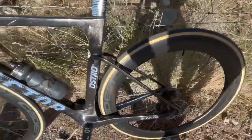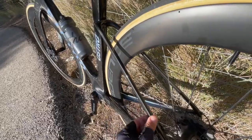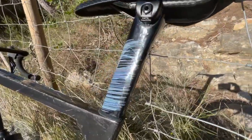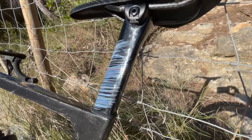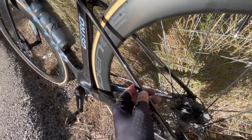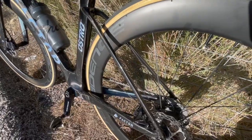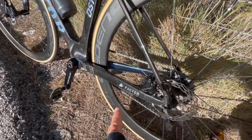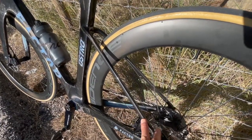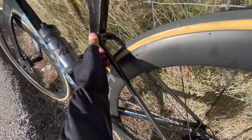The seat stays on the back here are very thin — pencil thin — which looks slightly fragile, but I think it helps give the bike a lot of compliance at the back, because these aero seatposts are normally quite stiff due to their profile. The danger is that if transported badly they can snap with a decent blow from the side — I've seen it before when tour guiding. That said, the chainstays are so thick and strong these days you could almost do away with the seat stays entirely — they're essentially a brace, and aero obviously.